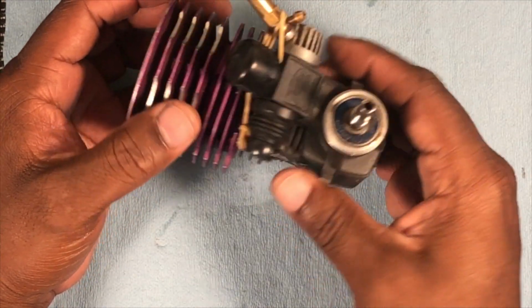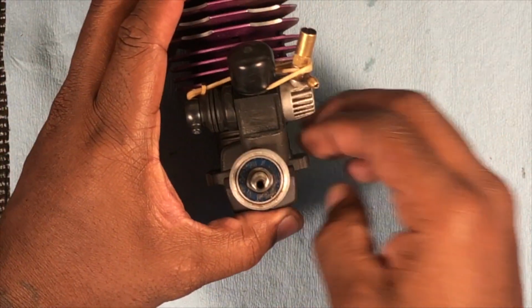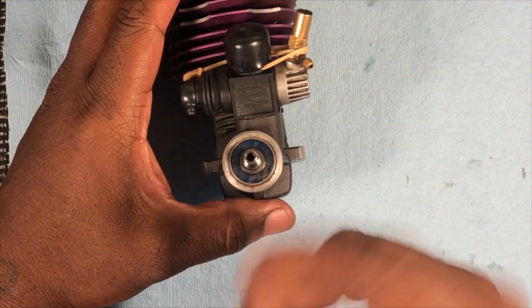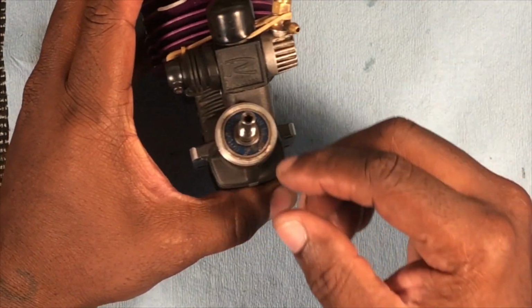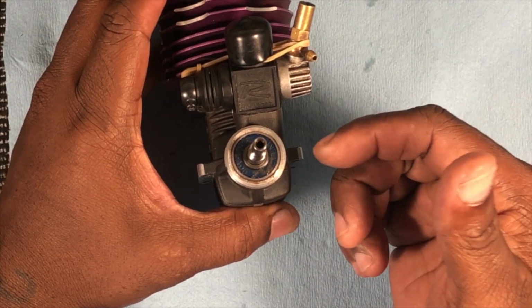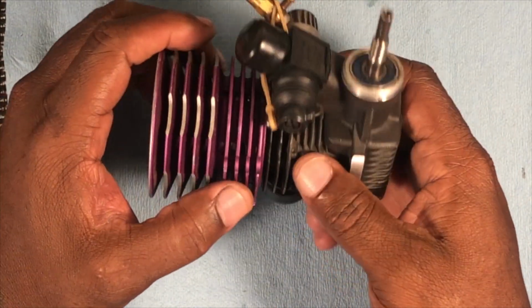difficult to tune. So normally I begin to think of the front bearing, especially when it doesn't want to idle, or you nail it and it keeps dying no matter what you do with the tune. It just keeps flaming out. What happens is they build up air. The seals around here get bad, and it starts allowing air in. So now you're getting more air into the motor, and the motor is actually running leaner.